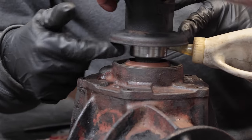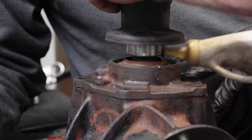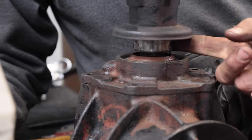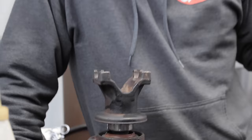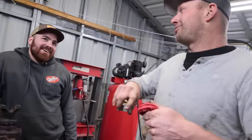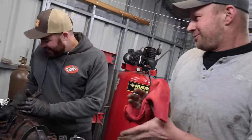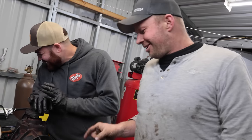So you always want to lube up every single rubber seal in anything you're putting together, really. No, can't always say that. Lots of seals, it says do not use oil. Can't say always, Jacob. The internet will eat you alive. The Honda 2004 CRV rear main seal on the output shaft says no oil. 99.99% of the time, you want to lube up the rubber.